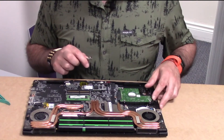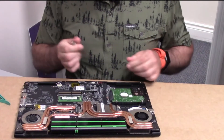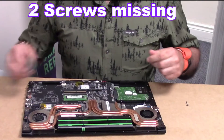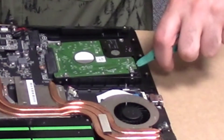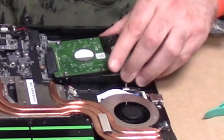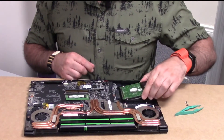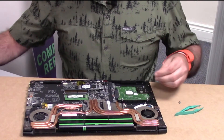For the regular 2.5 inch hard drive, take out the four screws on the sides. Then using a pry tool, squeeze in between the plastic housing and the drive until you can lift it up just enough to grab hold of it and slide it straight out. To put the new one back in, just reverse the process — slide it back in and remember to put the screws back in.